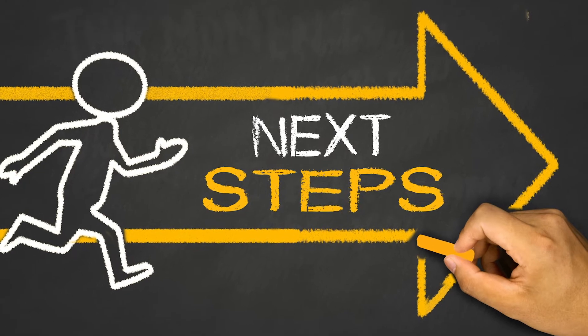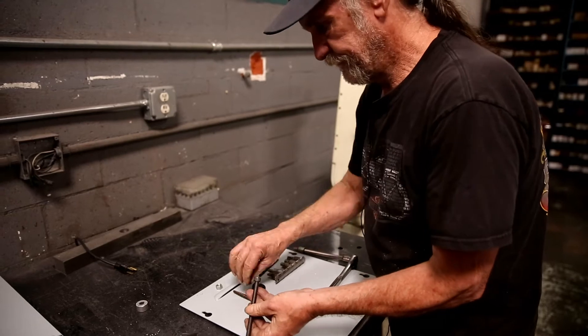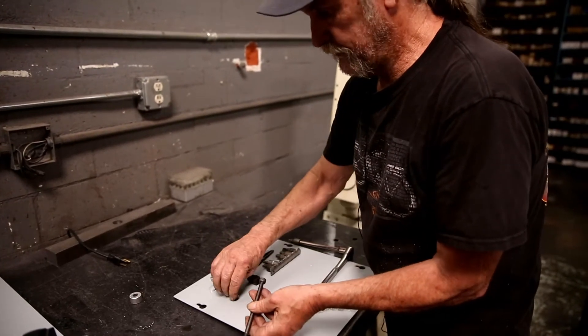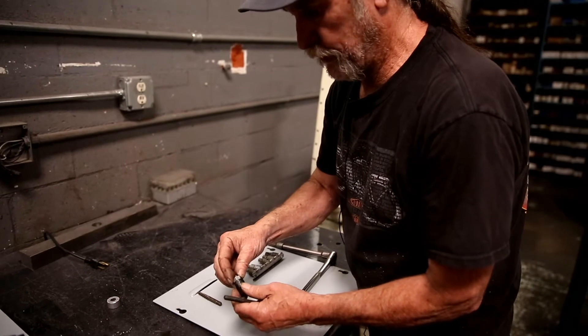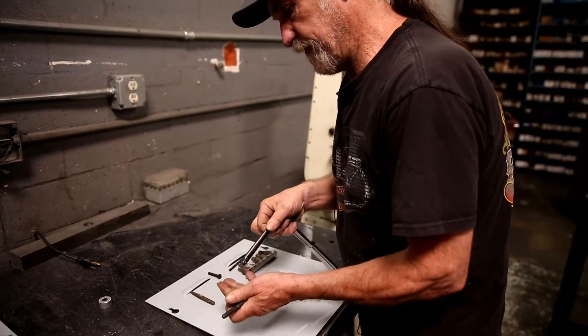The next step is for you to drill the head. Or, my favorite method, is to get a nut extractor. The nut extractor has been made for hex nuts when you round off the corners of it, and you use it with a half-inch drive.